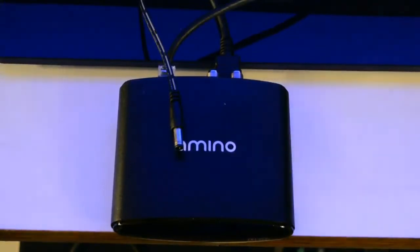You might run into an issue where you have a picture but no sound, or your picture might freeze. Something might lock up in your system, and so you would have to reboot the set-top box. It is not something that should happen often. If you find that you're having to very frequently reboot your set-top box, please give us a call at one of our offices, because that should not be happening, and we can try some different things, maybe some different cables or some fixes that we can do to correct that problem. But if it's something that happens rarely or just every now and then, it's not a big deal, then rebooting your set-top box is a pretty easy thing to do.